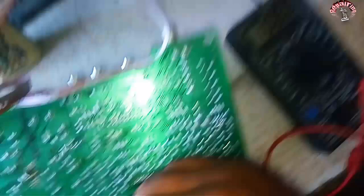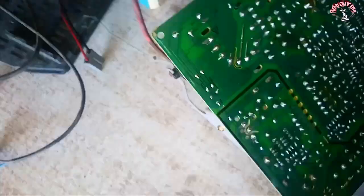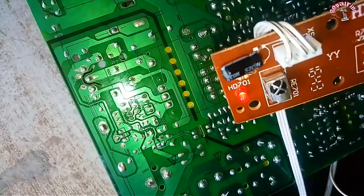Here we can see how many different wires there are. There are 108 volts — so this is our supply which is okay. This is the flyback, which is the horizontal section. Our key panel indicator light confirms that this supply is okay.